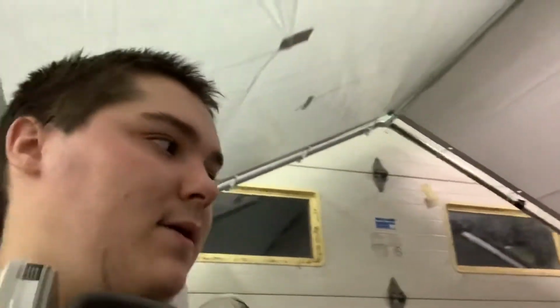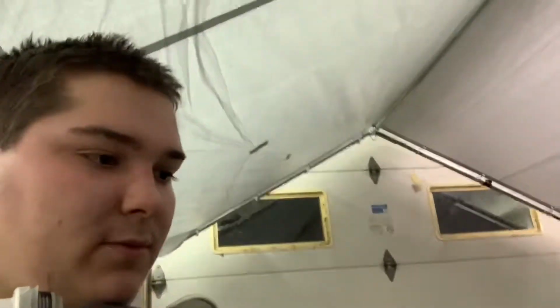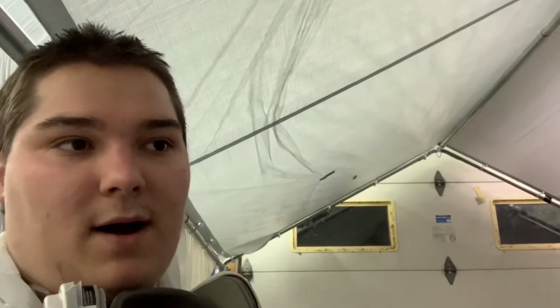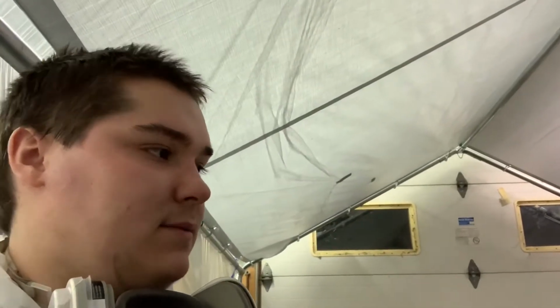It wasn't too expensive. I'll show you guys the sealer in a minute here. It's from Nason. It's not a 2K, it's a 1K sealer. So I don't know. We'll see how it works. Normally I like to use 2K stuff, but for a whole gallon it's like $100. It's not too bad. But everything else came out good. A couple little bugs in the paint, but it's fine because I'm gonna go over this sealer with like 600 grit to really make sure that the paint job will look good.